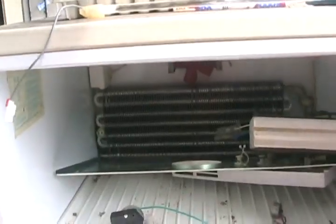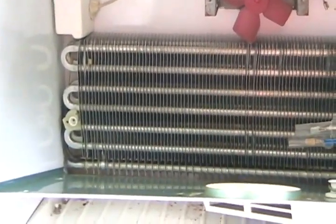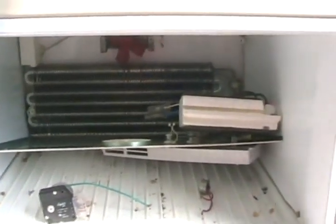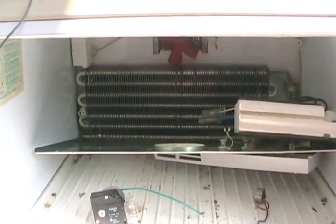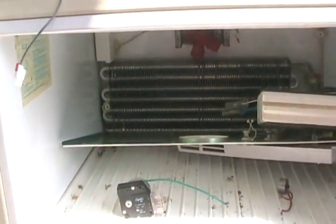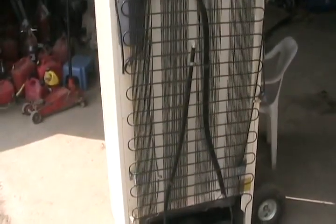The other most common place fridges leak is the evaporator coil, since it's made of thin aluminum. The thing that damages it most — which even eats copper — is tomatoes. People who frequently freeze or process tomatoes, or store tomato paste, sauce, or juice in their fridge, find their fridges don't last as long, because it creates an acid that eats through the coils. The least common place a fridge leaks Freon is actually the condensing coil.